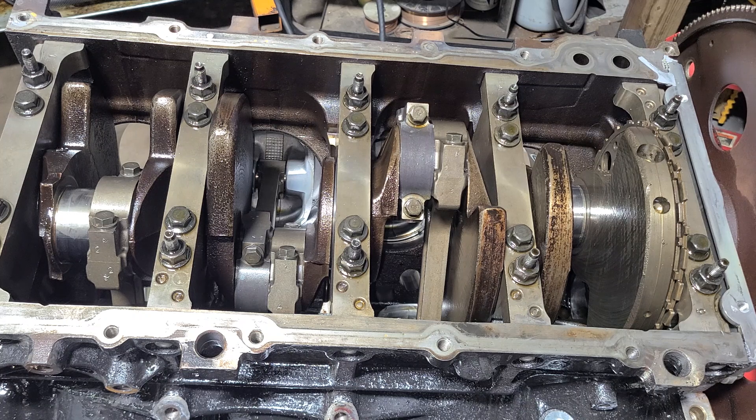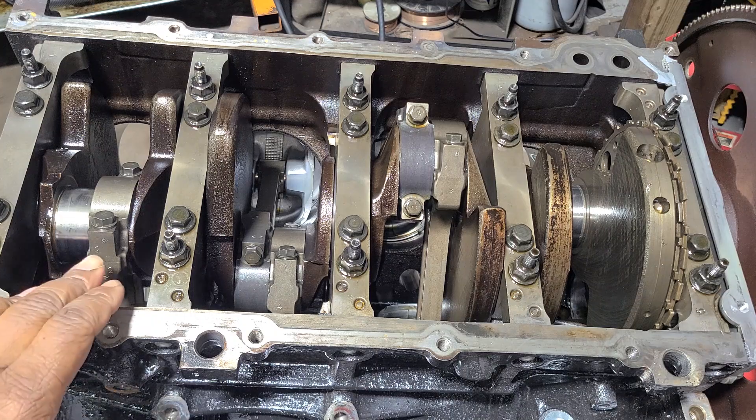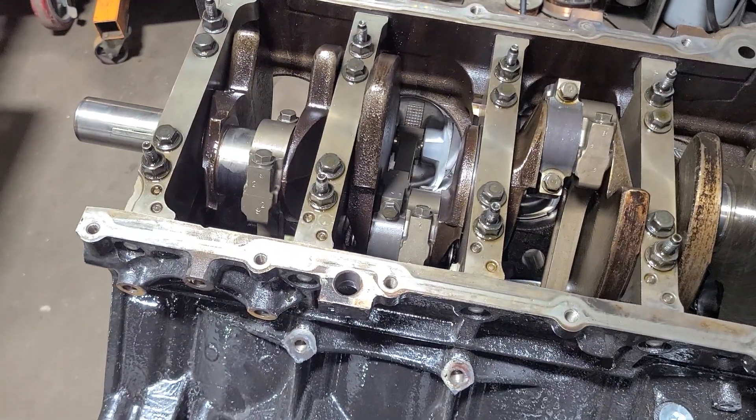But there is one thing that you can do that will cause you a lot of harm. We have a short block right here — it started to spin a bearing. We caught it because we saw that the filter had a lot of debris in it. And the reason why that happened is because of right here. Let me zoom in for you.